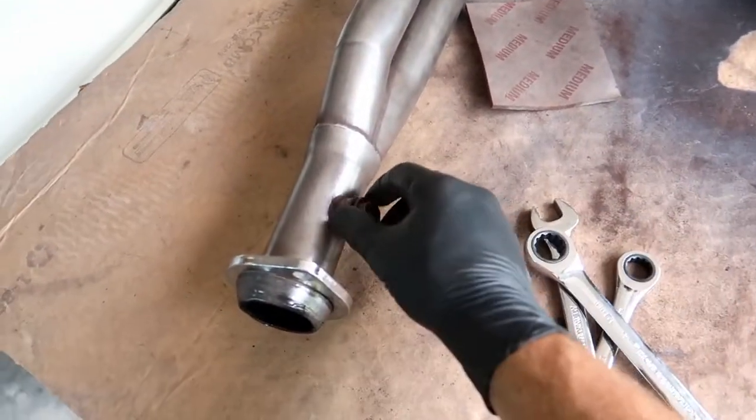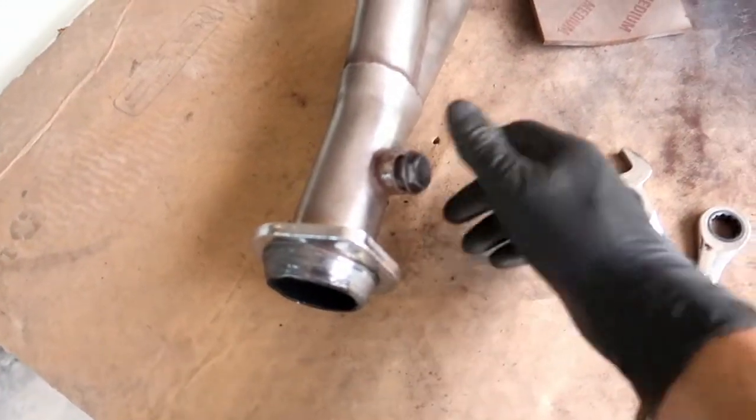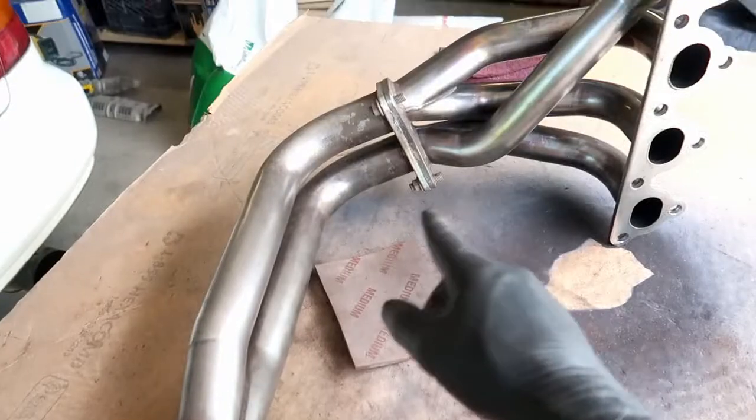This was actually a little more rusty than I expected. I took the stud out, ran it on the bench grinder, and was going to put some new thread lock in and put it back in — I never really need to use it, it's just the one up here I need. It's pretty much time to blow it off, clean it really good, hang it, and shoot it. There's not really a whole lot of prep — pretty much scuff it and shoot it. Spraying is what takes a long time because you need two or three coats of primer and then two or three coats of paint. If it covers really good you probably only need two, but I'd recommend three. If it's not covered enough, put four, five, even six — it won't hurt. Just put it on in thinner layers and wait a little more between coats so you don't get runs.